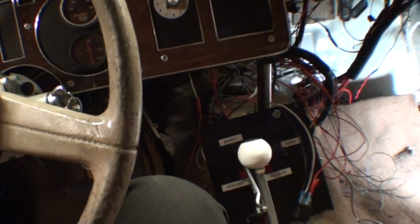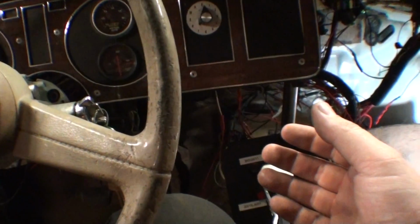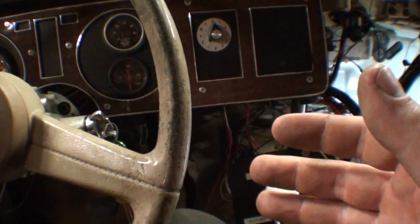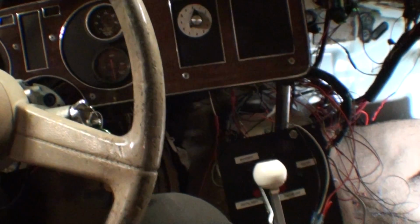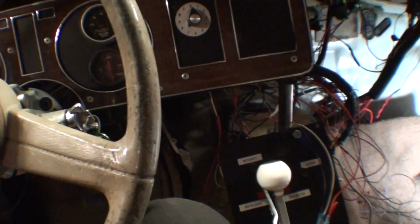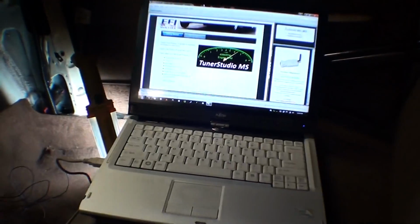But you mess with this until you're at a comfortable amount, and then you can bump into the second bulb with the car just steaming and ready to go, and then let go of your trans brake, and the car flies, full boost, full RPM, no waiting. You can cut a pro light, which is awesome if you can even do that, but the car will be ready to go. So here is the thing.